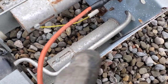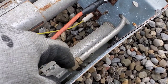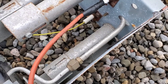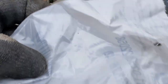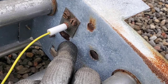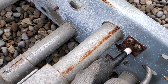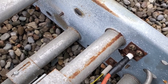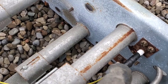When you remove this tubing, there's an orifice in here that is crimped onto the tubing. I recommend you get a brand new orifice every time you change one of these — they're inexpensive and it gives you insurance that the machine's going to run better. There are little clips, kind of like nuts, that you've got to spin off to get this tubing off. When I'm done, I don't put those back — I like to get actual nuts instead of these clips.